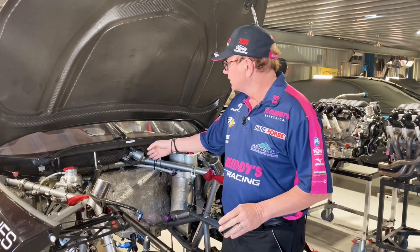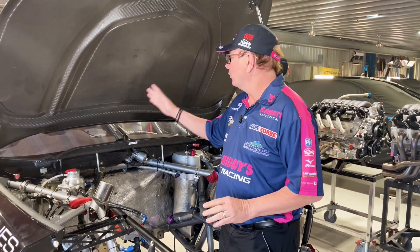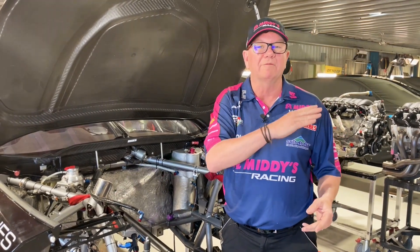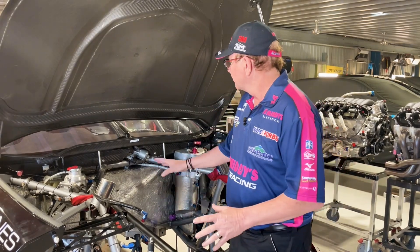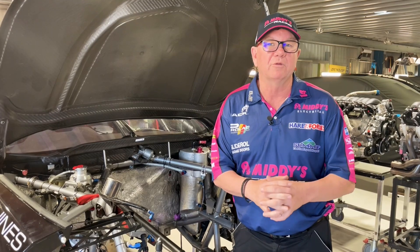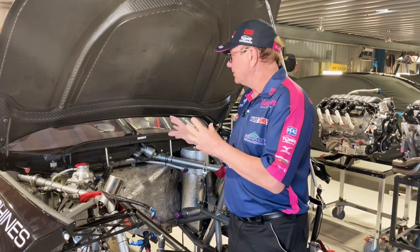It also, when it's a Bosch, you have to specify whether you want to go to the right or the left first, and that depends on whether it's a right-hand or left-hand drive. If it's a right-hand drive car like we have, you want to sweep to the right first so you can see where you're going. So even though it's a tiny component and it's the same in all the cars, there's a fair bit of thought that goes into the wiper motor — position-wise and the actions that it performs.